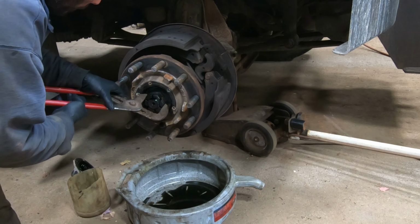So I'm going to lubricate these bearings, put them in there, seal in, or at least I'm going to put the rear one in, put the seal in, and then I'm going to put the hub back on. Then we'll put the outside bearing in, and we will preload and then set the torque, and I guess the preload on the bearings.